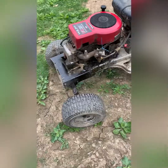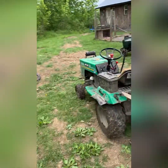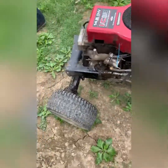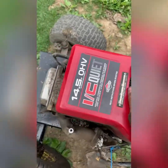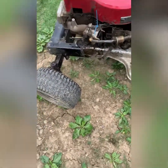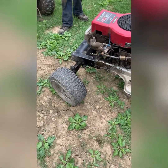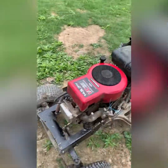The front end is done. The 10 horsepower motor — I don't feel like messing with the starter. I've got this 14 and a half horsepower second motor that's blown up — it didn't blow the connecting rod like it normally does, it just has no compression whatsoever and it's blowing oil out like crazy. But the front end's done. I got to drive her for like five minutes — she flies, front end held up. But yeah, I blew the motor up again.